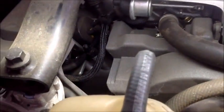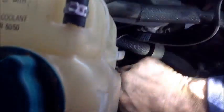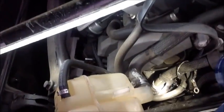So that's one bolt that has to come off. Number two, there is a ground strap that comes across here to the frame — that has to be removed. The other thing we're removing is that since the belt has to ride behind all this — and this is the power steering pump — anything that falls in the way of that you have to remove.